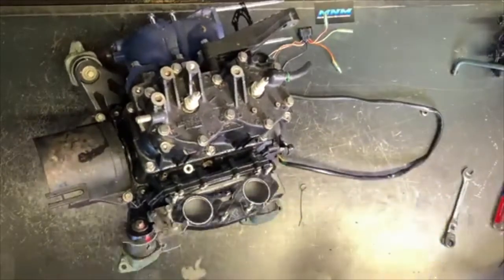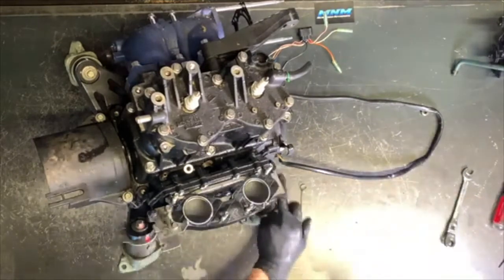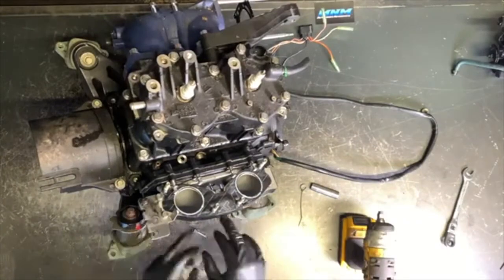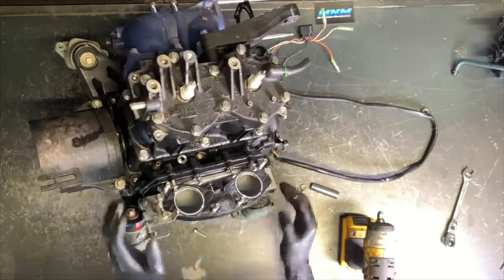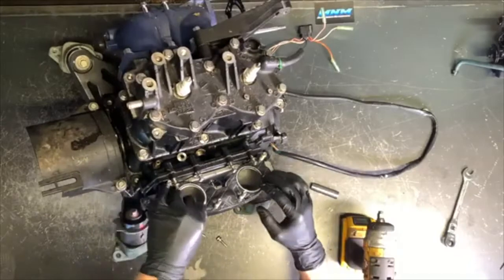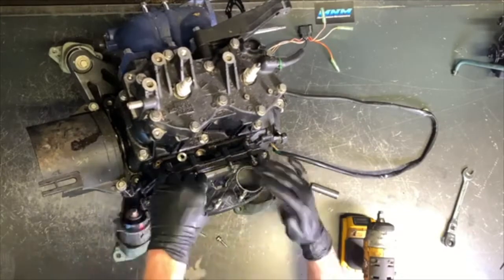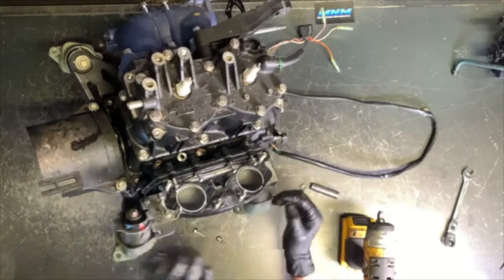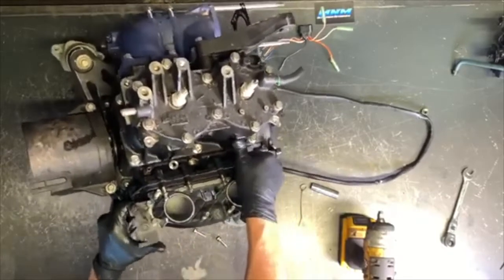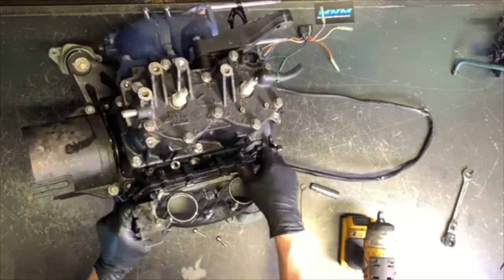We've got your intake manifold here with your reed valves underneath. I'm going to take a 10 millimeter socket and pull all of these off. You've got one directly in the center that's hidden back in there. This is called your intake manifold. You do want to make sure if you do a carb rebuild that you replace this gasket here so it seals up. There should be about eleven bolts total. You might have to tap on that a little bit — but don't use a steel hammer because you want that to seal up.